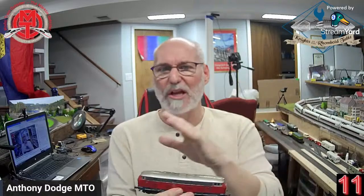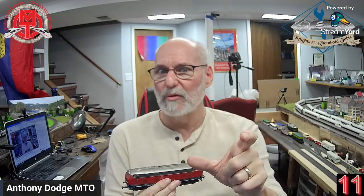So I'm going to go ahead and use this as an experimental where I'm going to buy the kit. It's only $25, and you get basically 1.5 motors. You get the kits to replace, because some of these motors have 7 spokes on the cogs and some of them have 8. So you get both. It'll change it from a 3-pole to a 5-pole motor, but on the gear, it can either have 7 teeth or 8 teeth. And so they send you both of those types of motors. And then the armature is the same. So you just take out the old motor mounts and everything. You take all this out, attach the new ones to the axle, put the new motor in, and then wire the decoder up.